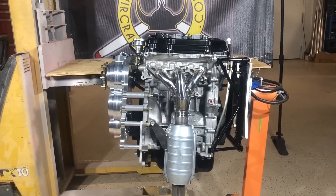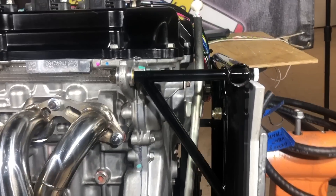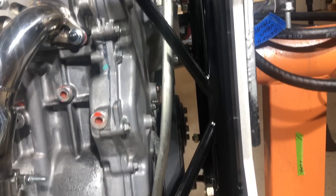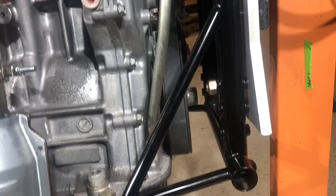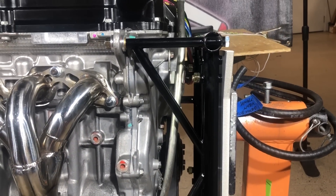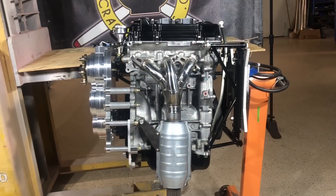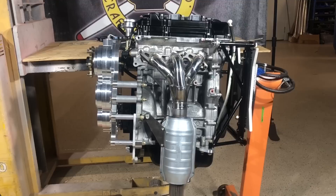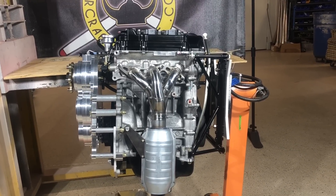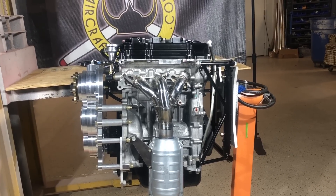Here's the other side of the engine. We talked about the cradle earlier — here's a bit more about it on this side. It's attached to the main engine block as a triangulated 4130 steel weldment bolted to two tabs on the engine, for a total of five different bolt locations, giving the customer an easy way to mount the engine to the airframe. Viking also fabricates engine mounting structures for various airplanes, along with cowlings, propellers, spinners, and other accessories.